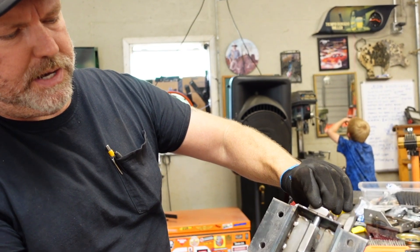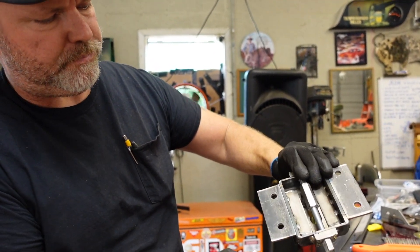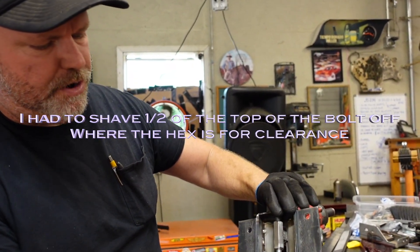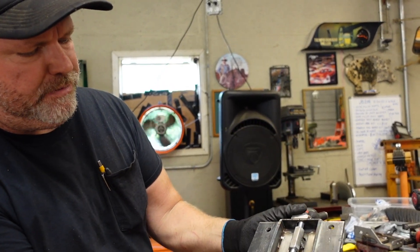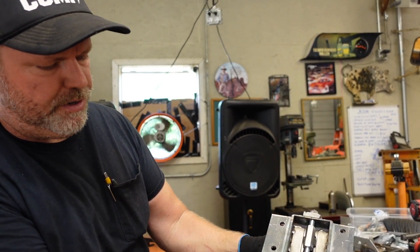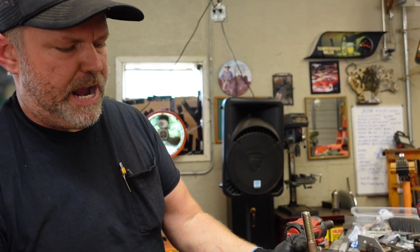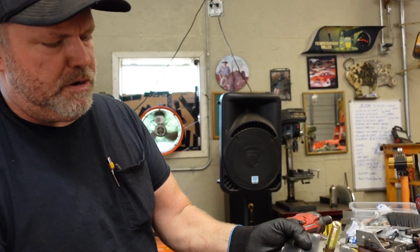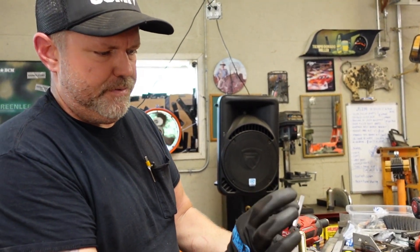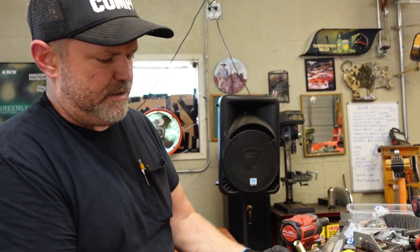As you can see, you can see how it works. It's a coupler nut welded to the top of this 5/8ths grade 8 bolt, inside of this C-channel. It's got guides so it can't turn. It's got a captive 3/8ths threaded rod - you turn either side and it'll move the idler pulley shaft up and down. It can move maybe about an inch and a half or so. On the top side it's going to have this shaft collar welded to a piece of plate that fits in there so it can't turn.